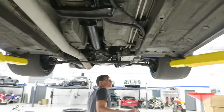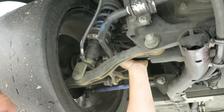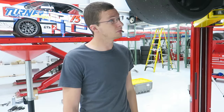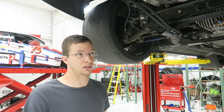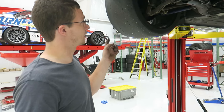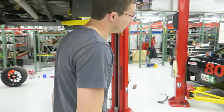The only issue is this axle back here, which has quite a bit of play now. We're going to order some axles up from Insane Shafts and give those a go — hopefully a little more durable. These OE axles seem to last about five or six track days, and I've twisted the shafts in half twice, overheated an outer CV, and gone through two inner cups. So it's time to upgrade and see if they don't break on the GTS4.